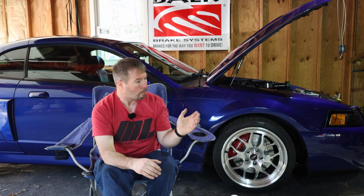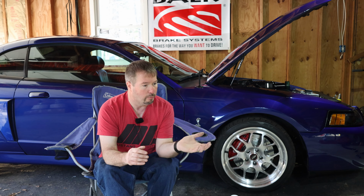So when the car goes down to Cobra again, I'm going to have him weld the cats in, get the tune updated for the cats, have the powder coat and stuff done, and fix that coolant leak, and the car will be pretty much all set for the summer. I don't have any other lingering issues or problems with it. I just had it driving for a good half hour and got everything up to temp. Temperature's good, the supercharger coolant temp's good, so the pump's working well. There's really no issues with the car other than that pesky little coolant leak from the oil cooler, but like I said, it's not too big of a deal.